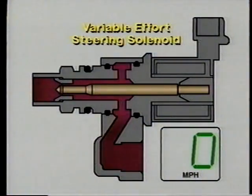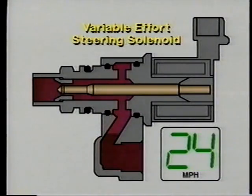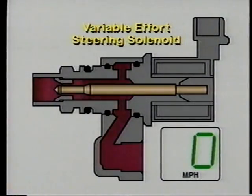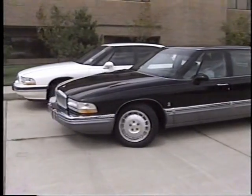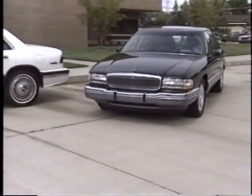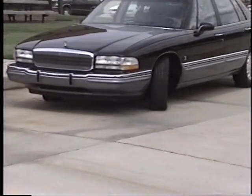The Chime module energizes the solenoid when vehicle speed is increasing up to 20 miles per hour, or speed is decreasing and is less than 17 miles per hour. Solenoid activation times out 3 minutes after the car has stopped. When energized, the 2-flow solenoid allows a higher volume of flow from the steering pump to provide increased power steering assistance for slow-speed maneuvering.